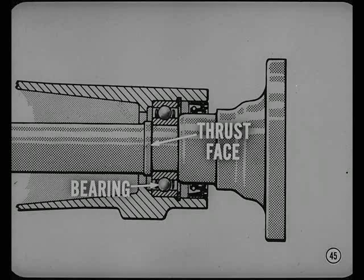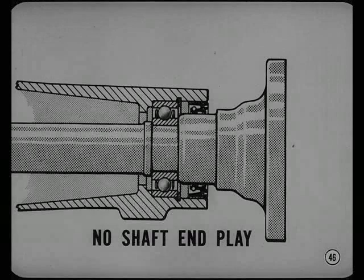The extension bushing in an A904 TorqueFlite transmission is replaced by a heavy-duty thrust-type ball bearing. You can service the new bearing and seal with current special tools, though. With the ball bearing, there's no output shaft end play. You check end play in the transmission gear train at the forward end of the input shaft, the same as on the A727 TorqueFlite.